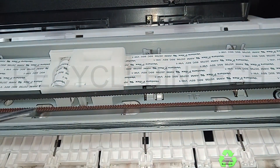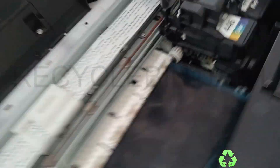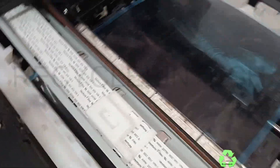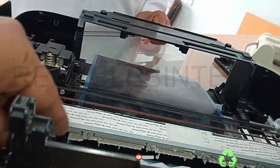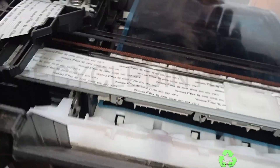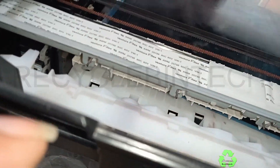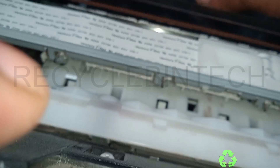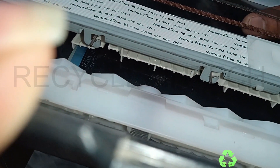It's gone inside now. We will see from the back side — remove that X-ray sheet pulling it upward toward the back. While doing this procedure, in most cases — like 99 percent — whatever is stuck inside will come out. If it's not coming, just do it two or three times: front side to back side, front side to back side, to remove the thing which is stuck inside.